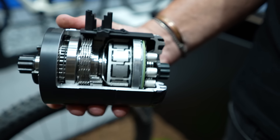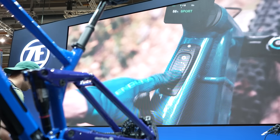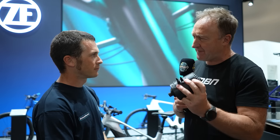There's a clutch inside this motor — which makes it quite different. Rather than the current to the motor cutting out every time you hit a lip while climbing, the clutch activates so you keep moving forward and maintain motor momentum. When it comes to tackling technical climbs, that's a real performance advantage. The hardware is in place and the software is being improved daily — they've been taking it down the jangling trails around Nice to develop the tech further, with more features coming for the product launch at the end of the year.